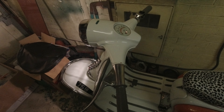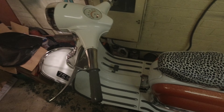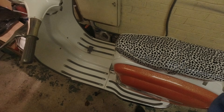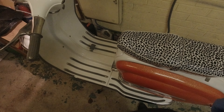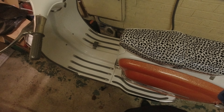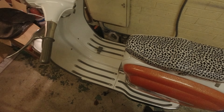It's running full DC, so the ignition is just doing the ignition, and the old lighting coils — all they do is via a full wave rectifier — is charge a battery all the time. So when the engine's running, it just puts all the charge into the battery. This Lambretta has not been started the whole summer.